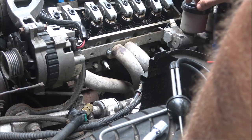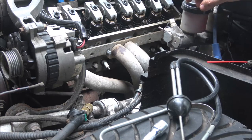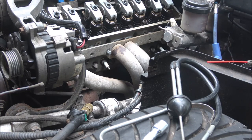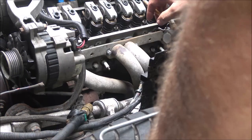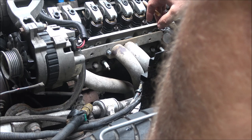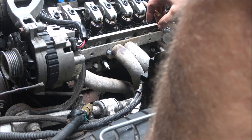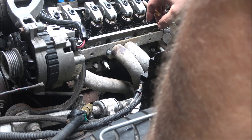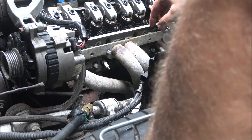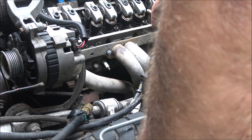So that's what I'm gonna have to do. I'm gonna have to get the right hoses to do a leak down test on it. What you do is you fill it up with pressure, you shut your air off, you unplug the air, and it should stay that way. Then you come back in a little bit, and you watch your gauge, and it shouldn't lose any pressure.